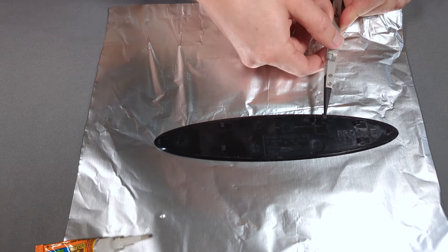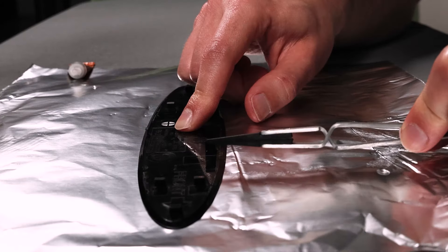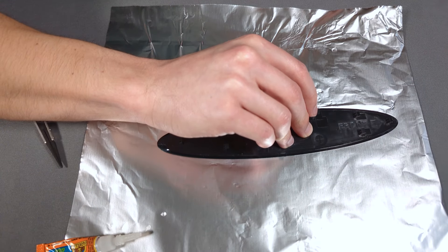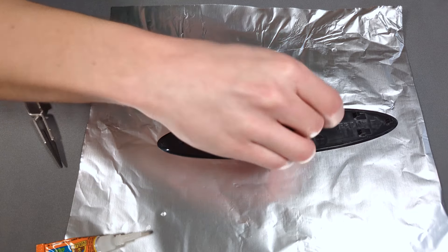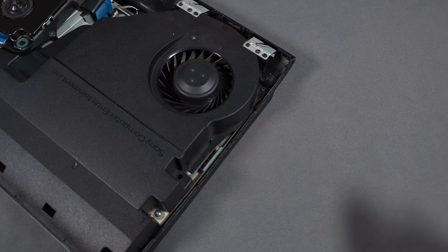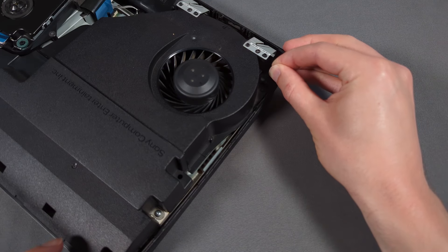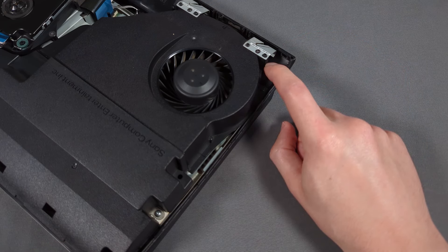You can also apply the glue to a toothpick, then use the toothpick to apply glue to the part. It pays to be careful and patient here. It's very easy to make a mistake and have the glue run out of control, and once it gets on your fingers, you only have a few seconds to free yourself before damaging your skin, your work, or its appearance in the final product. Once you've applied your glue, just hold the glued piece to the rest of the part and hold it as still as you can for 30 seconds. Small parts may hold fast without help. Be careful not to wiggle the parts while the initial bond cures. After 30 seconds, the joint should be strong enough to hold the parts without any additional force and can be left to cure overnight.